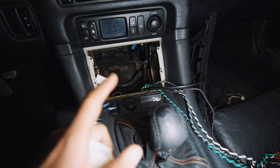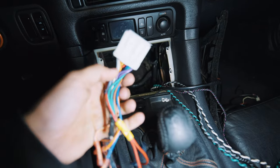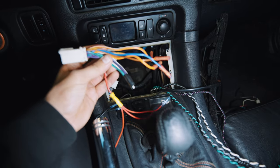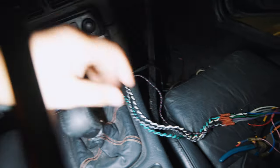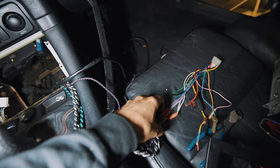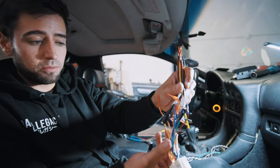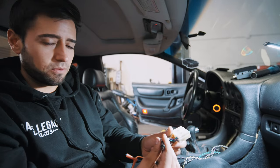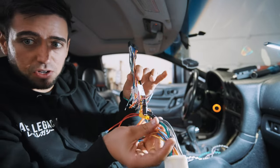Normally how the OEM wiring would work is you have the OEM harness here. You have the harness that you would have to buy separately — which I linked in the description as well. You then have to match every single wire into the double-din harness. But the issue is, since this thing already had aftermarket wiring, these are aftermarket speaker wires, so it becomes a big mess and a rat's nest that you kind of have to figure out. Normally when you buy the aftermarket harness, it would just plug straight in — this would plug into your OEM harness and this would plug into the back of the radio. Unfortunately, since we have aftermarket speakers, we won't be using the normal speaker wires on the aftermarket harness. If you have OEM speakers, you could just wire everything out separately, which makes the job much cleaner and simpler.